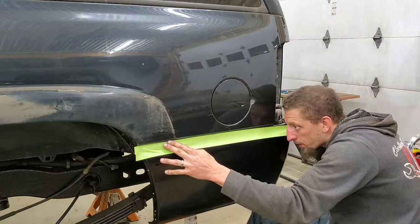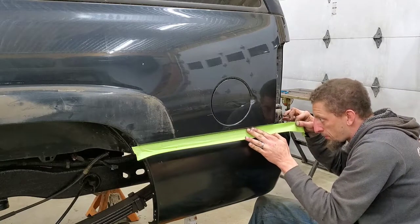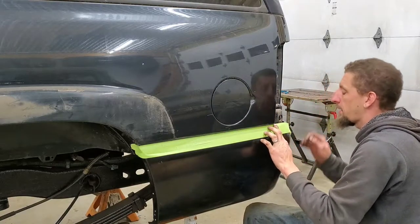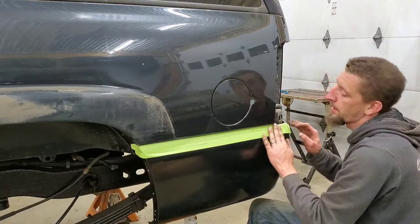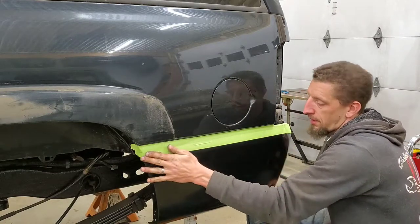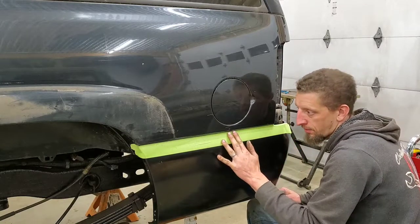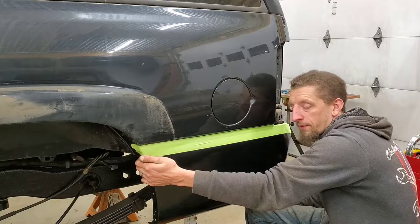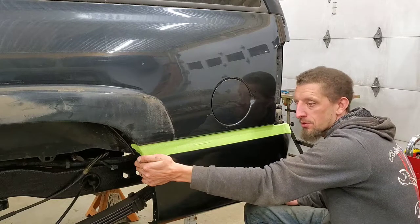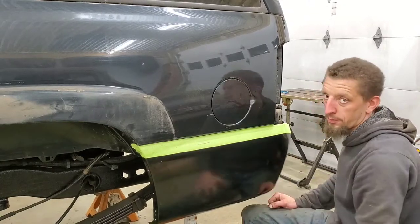And whether you're talking automotive or marine, sealants and adhesives are really expensive. And I was trying to be cost conscious, and I went shopping at Home Depot, of all places. And I found a polyurethane-based sealant adhesive. And I used it on my boat and subjected it to the salt and the sun. And it never failed. No cracking, no peeling, no fading. And it sat out in the sun and in the salt for over 5 years. So ever since then, it's just been something that I've had and used.